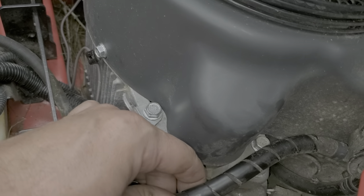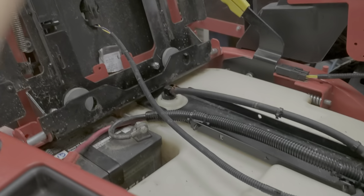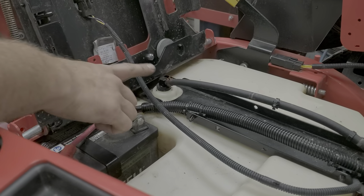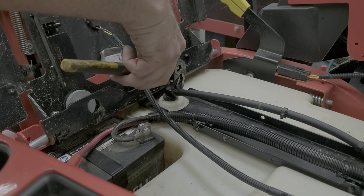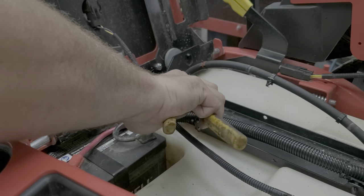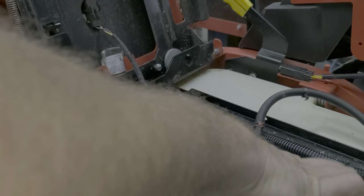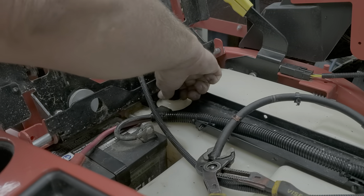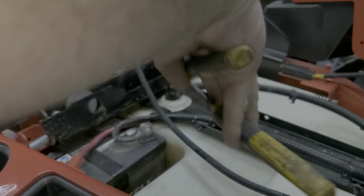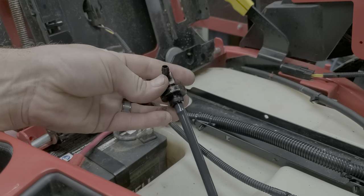If you're getting good flow and it's still shutting off after half an hour, you're going to want to check the inlet going into your tank. Almost always you've got a 90-degree turn coming out of every tank. If you pull that off and then pull the unit out, they'll come right straight up out of the tank.